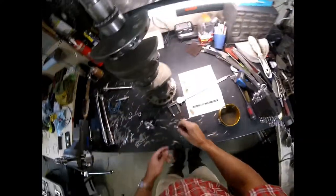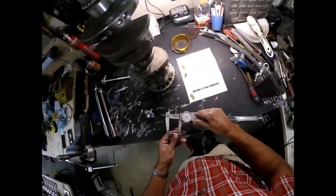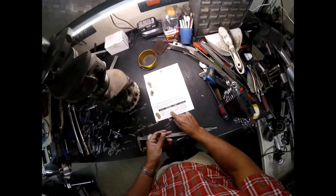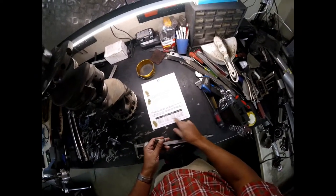So here's what we're going to do. We measure our bolt — this one is 1.4. We go to the chart: 7/16" by 1.4, so we want 30 foot-pounds plus 50 degrees.